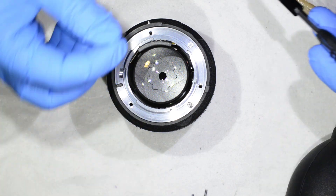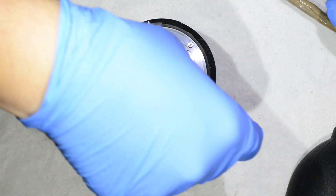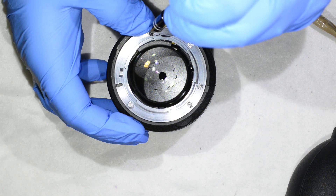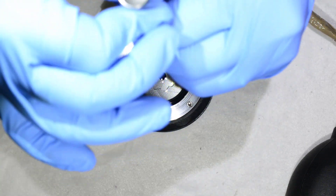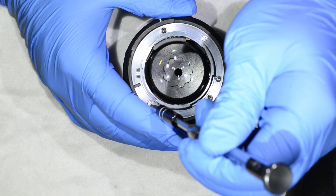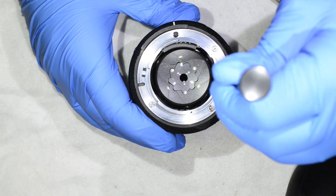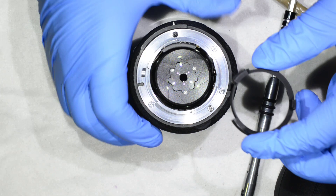Okay, this is it. We put the three screws for the bayonet back in, and I think I can leave you here because the end is just trivial. I just wanted to show you how to proceed, and as you saw it's a rather stressful procedure. You just need to be extremely careful: wear gloves, avoid touching the lenses, just blow — don't try to clean what is dirty, because I've had trouble many times spending two hours trying to correct smear traces. That's it — thanks for watching and see you next time.